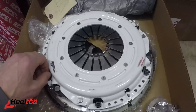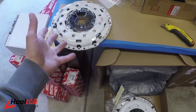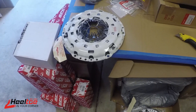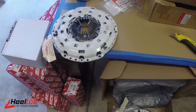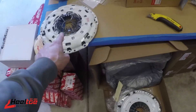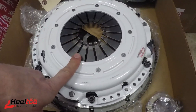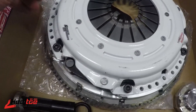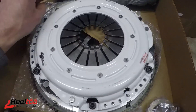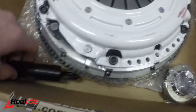If you've heard of people having problems with a Clutch Masters clutch on a J-series, it's probably because they had the self-adjusting one. There might have been something wrong with the pressure plate — Clutch Masters has always fixed that for people in our experience — but they also get installed wrong a lot. From 2016 and on you'd actually get one that looks like the newer non-self-adjusting style. I would say definitely try to specify, if at all possible, that you'll be getting a clutch with the non-self-adjusting style pressure plate.